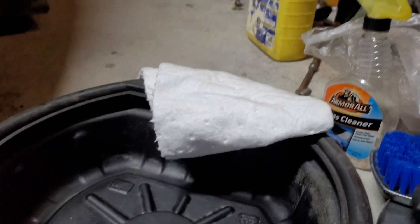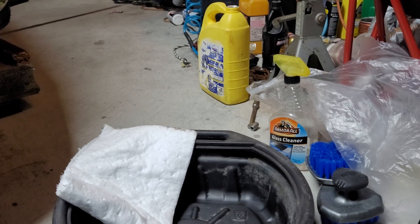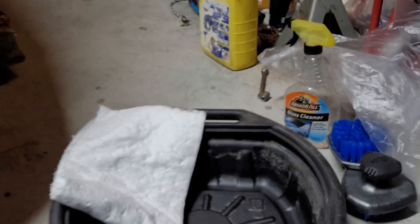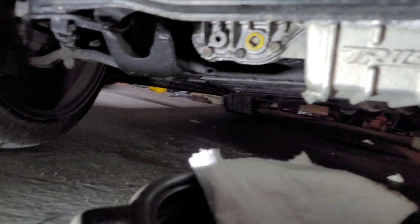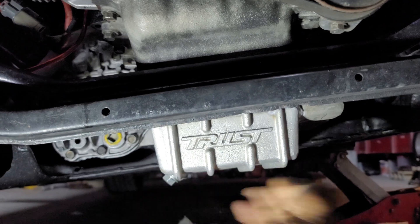What you want to do is get your oil checked and cleaned out. I got one of my buckets, my light, and a rag. Especially that first little bit — you want to check it, look it over, make sure it's not heavily thick or super thick flakes of metal. Let's check that out right now. Here under the car I've got my 17mm, got my bucket, see what we got. Just broke the nut loose and I'm gonna slide this under there.